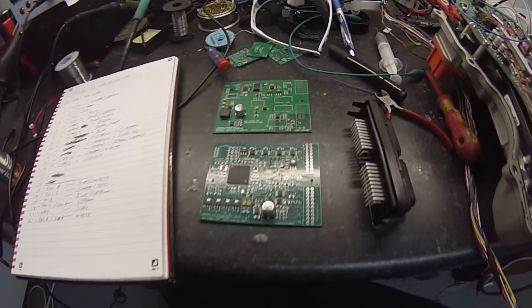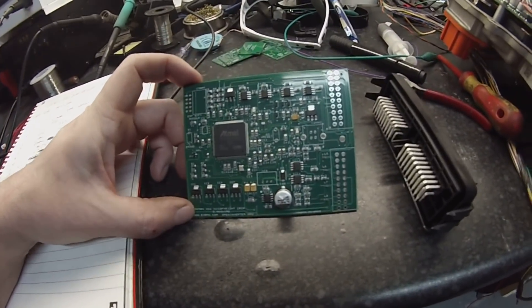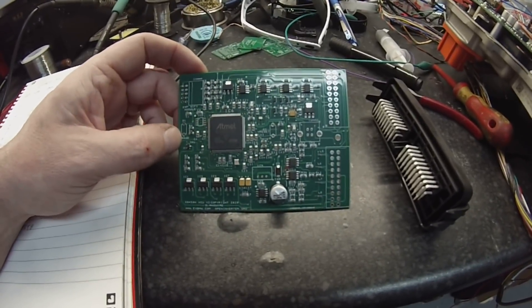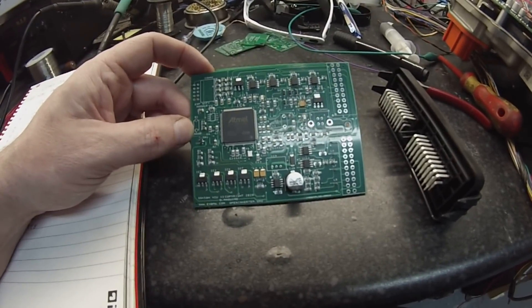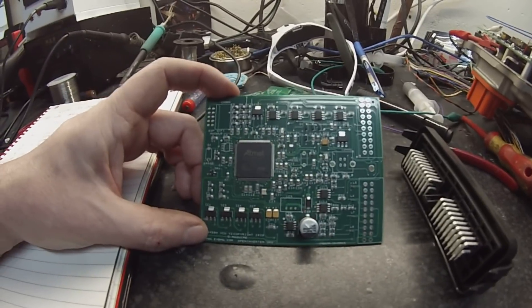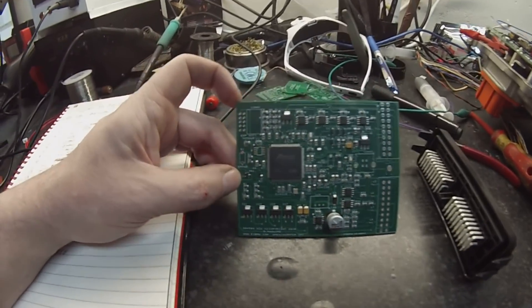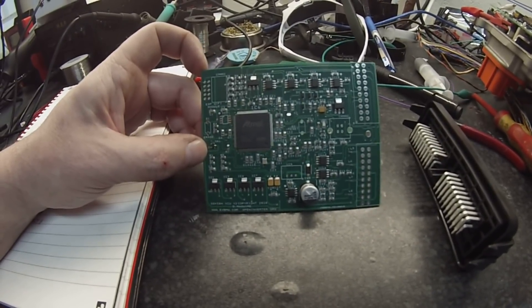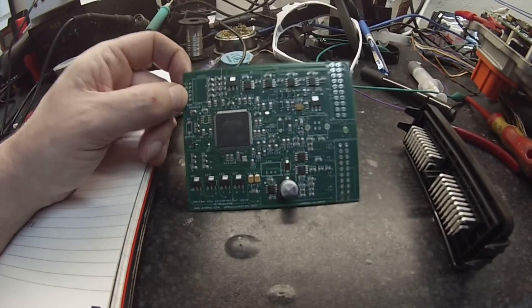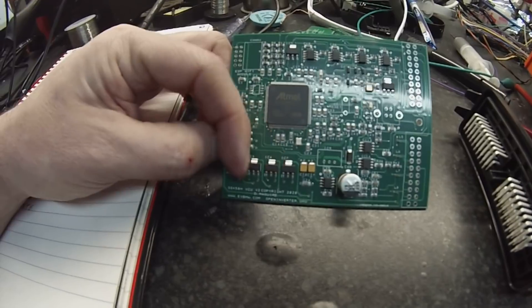Back in the lab — I'm going to show you a couple of little boards. This one you might recognize: it's a Lexus GS 450h VCU board we designed for using the Lexus hybrid gearbox and inverter. In this case we're going to repurpose it as a VCU for the Range Rover. It's not worth doing a custom board for a one-off build, and I'm certainly never going to use the Enova drive systems again. We're going to write custom software for this.